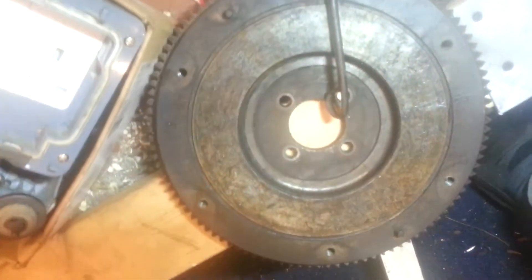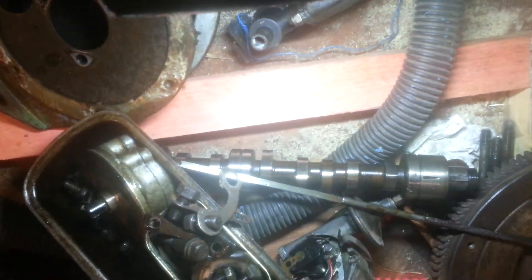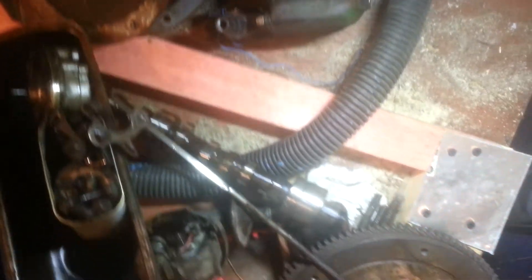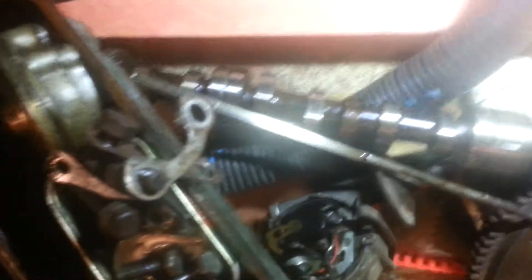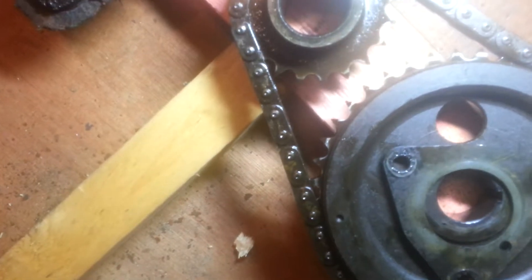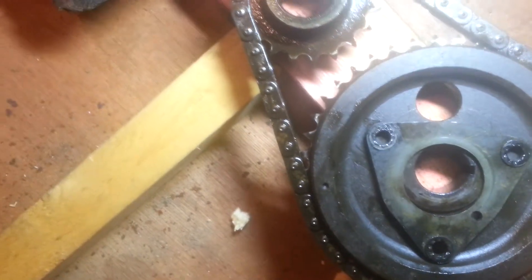I will replace that. What got me is that someone's greased this — see that — someone's greased the camshaft. That looks okay, that looks fine, doesn't even look worn. The lobes look a little bigger, I might be wrong, but the bearings are not good. There's the timing chain and cogs — they're worn to a point, which shows it's been worn. That chain has got wobble syndrome, so that's had it.